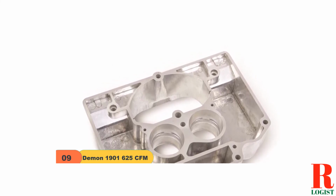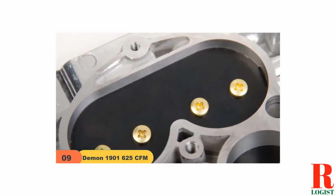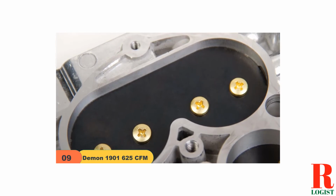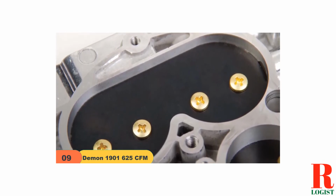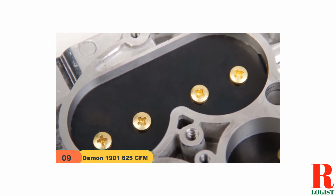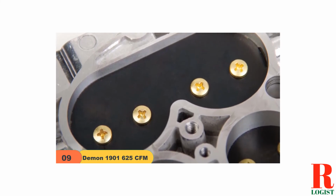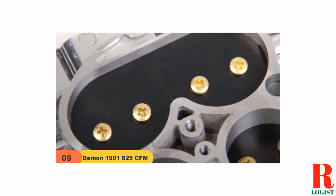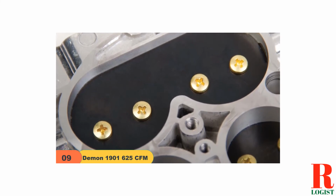Since the bowl comes with a gasket and is above the fuel level, you won't have to worry about any potential leakages. It also comes with an advanced feature that is the torsion spring valve control. It has the ability to provide a seamless primary to secondary throttle response. This carb is known to provide great fuel efficiency. With this carb, if you live in extremely cold areas, you will never face the issue of the vehicle not starting because it will make sure that you are able to start the vehicle easily.